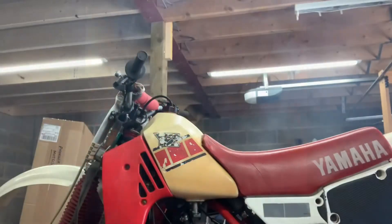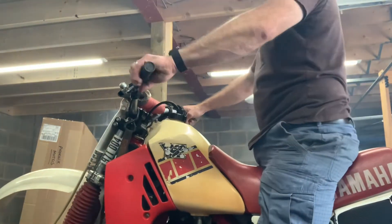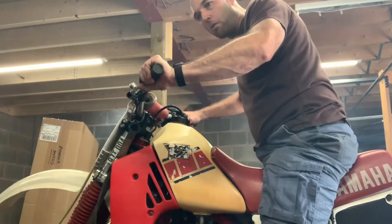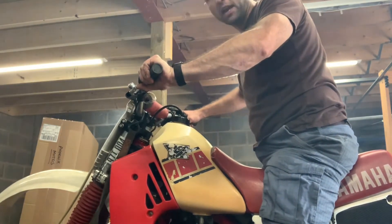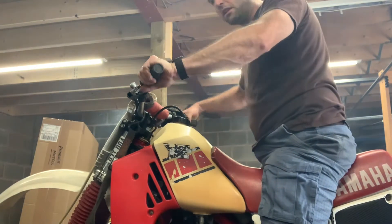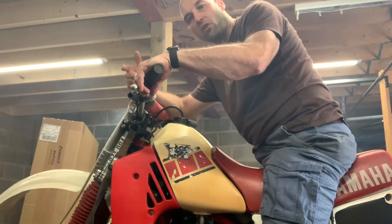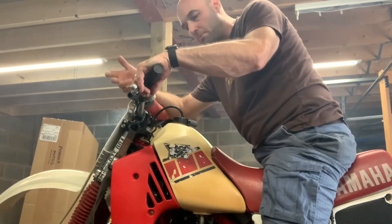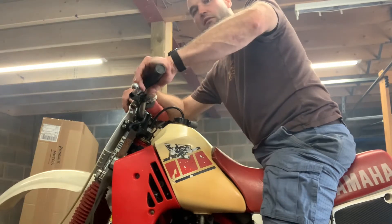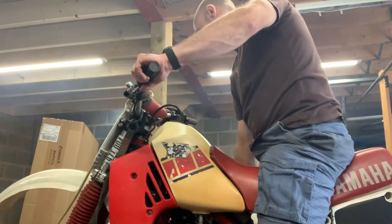I've just had her fired up — that's what I normally do, I try to get them running before videoing the start, because sometimes if they don't go very easy it can be a bit embarrassing. This one took probably about five kicks. It's a bit smoky, and that's often to do with stale fuel — the fuel will evaporate a little in the bottom of the engine and just leave a load of oil in there, so when it first starts after sitting for a while it's got to burn that oil off. Once I've ridden it, it should stop being smoky.